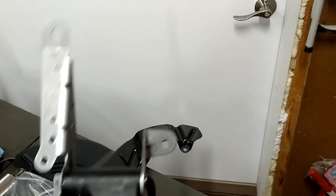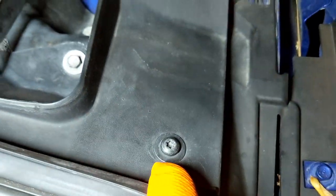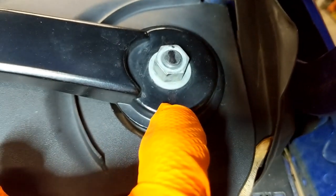I have to take the cowling off. There are little pushpins here — you just pull up on this piece right here and it allows you to pull it out. There are four of those. You have to take that bolt out there and take the screw out here. You have to take off the wipers and index them — you can't really see it but you index these because you can get them out of alignment. Take off both wipers and then this whole plastic piece will come off. When you reinstall it they put a nice little alignment mark there to know exactly where to line that up.